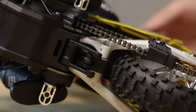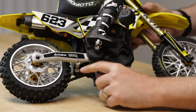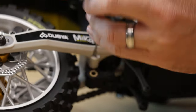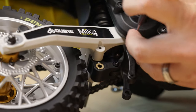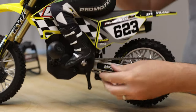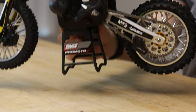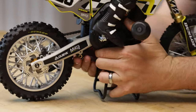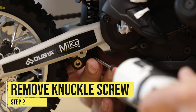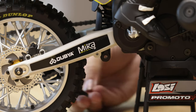Those parts are now separated. I'm going to flip the bike over — you can see here there's kind of a half-blind hole and we can go ahead and push those pins out through those holes. We'll turn the bike back over, pull the pins the rest of the way out. There's our pull rod, and the knuckle is still connected to the shock. You can see the bottom shock screw is still connected in the knuckle, so we'll grab our 2 mil and pull that screw pin out to free the knuckle.